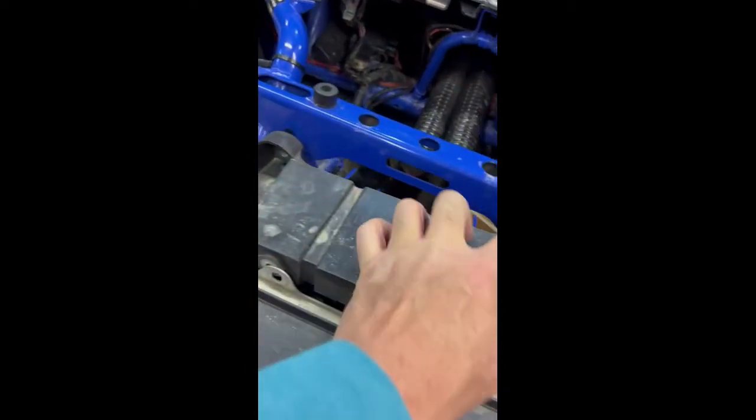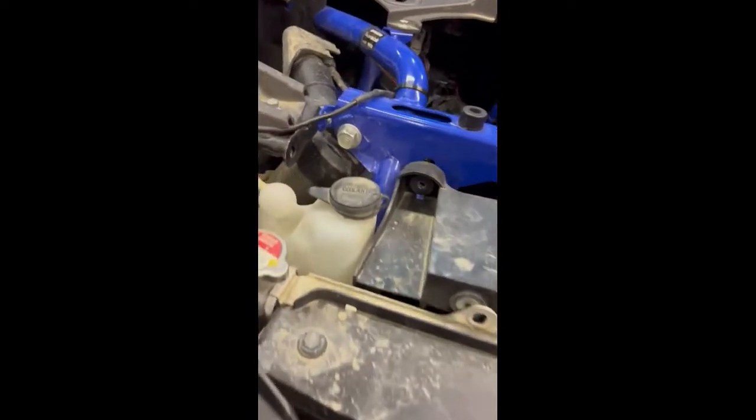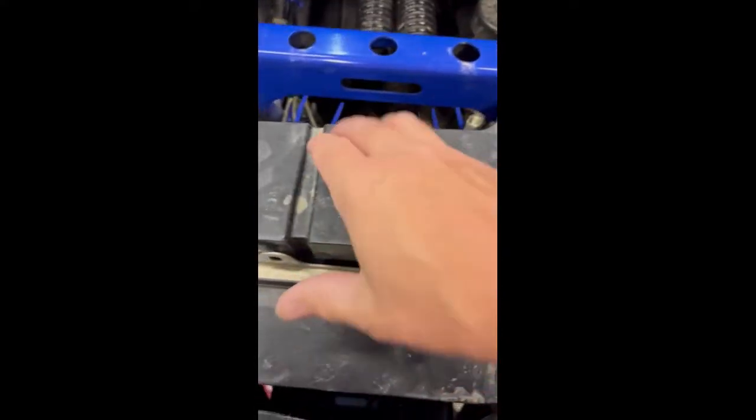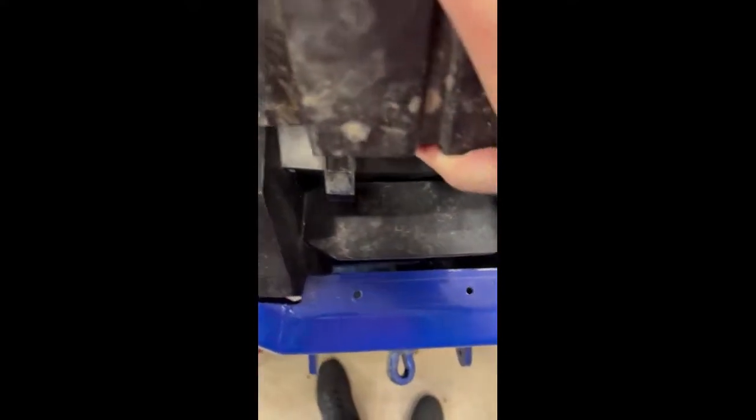To mount the adapter, pull the radiator fan shroud out. You have two bolts here, two bolts here, and two bolts that go down through the bottom from the front. Then pop off the coolant overflow lines for the tank and the radiator, and pop off the plug for the fan and the plug for the headlights — and the entire fan shroud and fan assembly comes out.